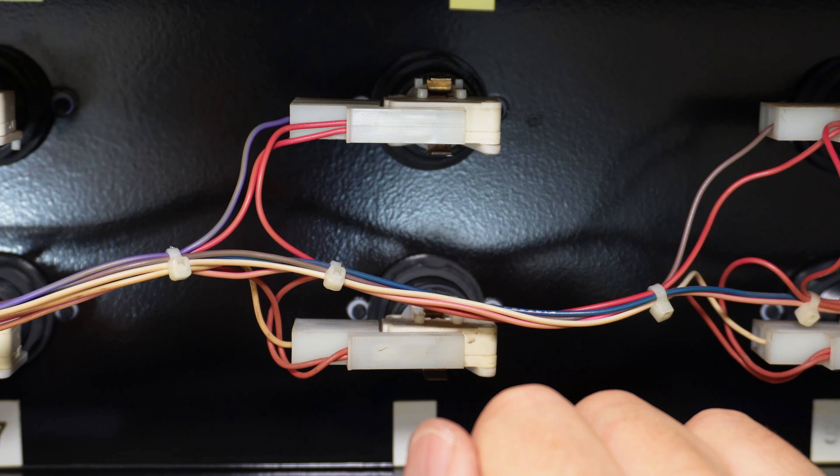I've got the panel back on. Now we're going to get in and test those relays. Selection button three wasn't working, and I actually timed out — looking at the front, I'm back to 'ice cold,' which means I'm out of service mode. I need to press the mode button to get back in. There we are — we've got 'cash,' so I'm inside mode. Now I'll press selection button one to cycle the menu until I get to the FRIG option. There's time — and there's FRIG.